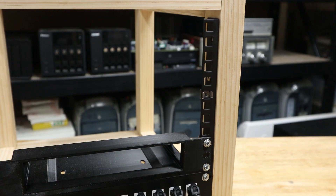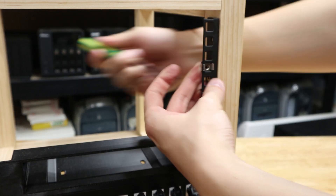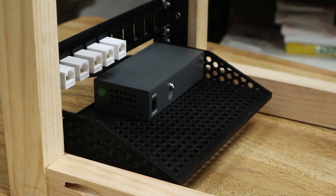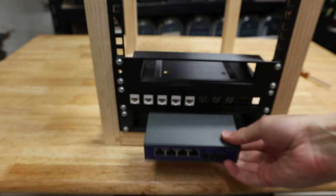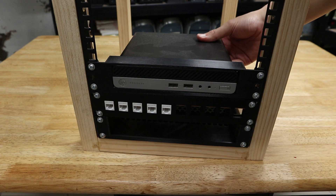You can find the links to the parts I had printed in the description. Since I used rack strip with square holes, I installed cage nuts and then installed the parts. I put the shelf at the bottom, the patch panel above it, and the HP mini above that. This isn't a final setup — rather just a demonstration that it works as well as any server rack should. I installed some keystone jacks into the patch panel, which clip into place very easily but still fit snugly. Finally, I put a little network switch on the shelf and slid the HP mini into its mount.